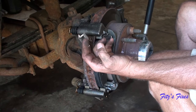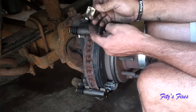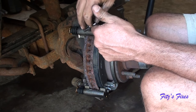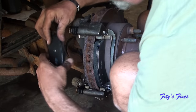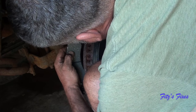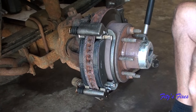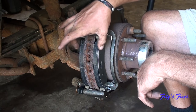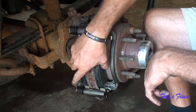I just put these clips on - they only go one way because of the spring-loaded design. You've got to slide the pad in through there, and if it's on backwards it just won't work. Some calipers have a little spring that goes between the two pads to keep them pressured out, but this kit doesn't come with them, so I guess it doesn't need it.